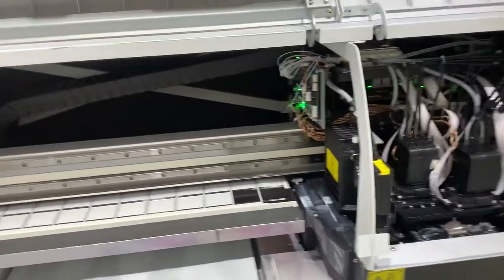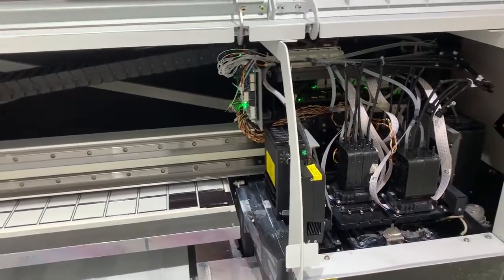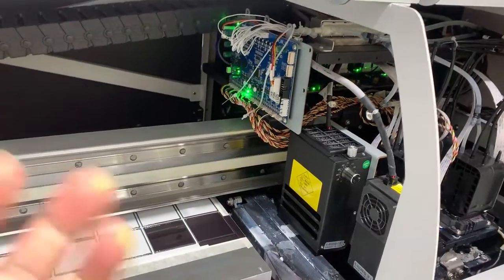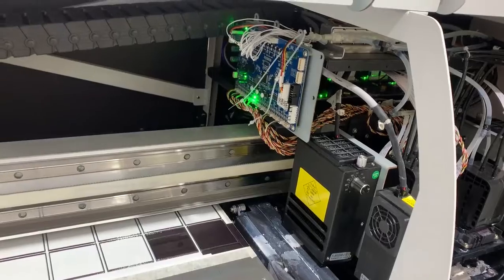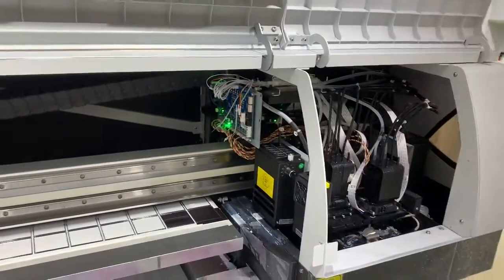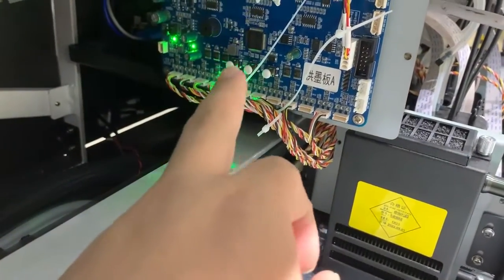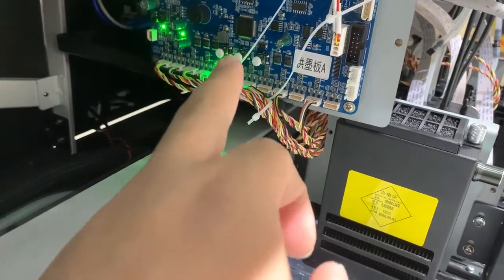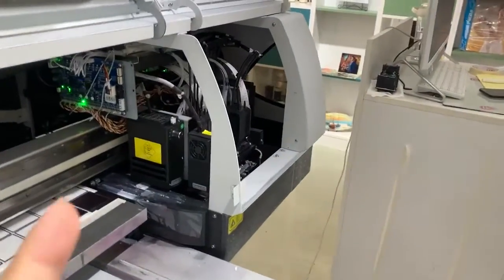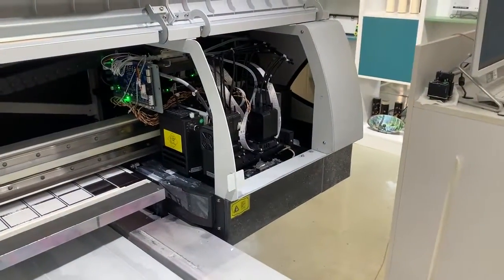It will be used to suck the inks from the ink tank to the damper. Usually after about 30 minutes, you can wait and see if there is an error report. Usually it is a ringing noise from this port. If this happens, press the reset button — the middle one — one time, and wait for the printer to suck the inks to the damper again.